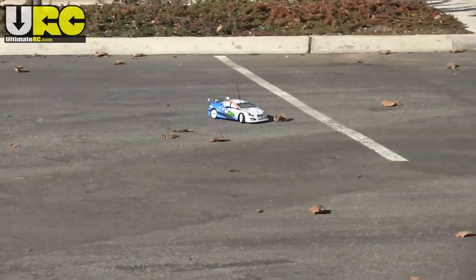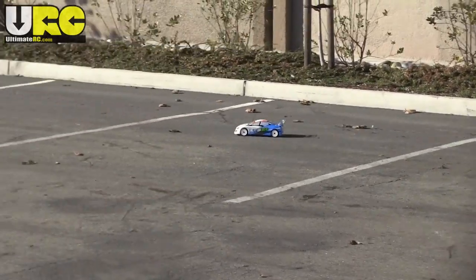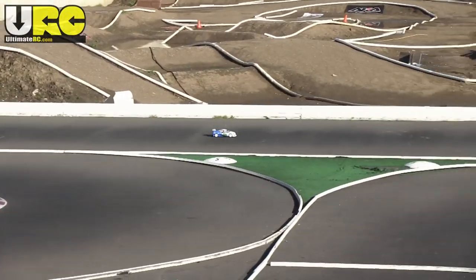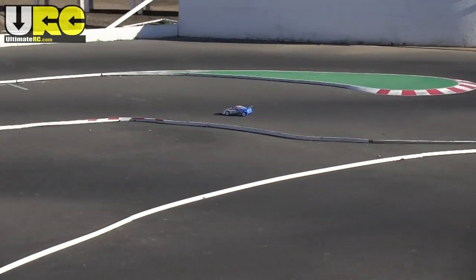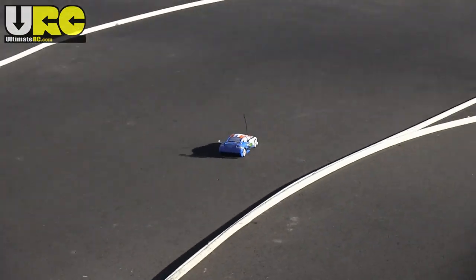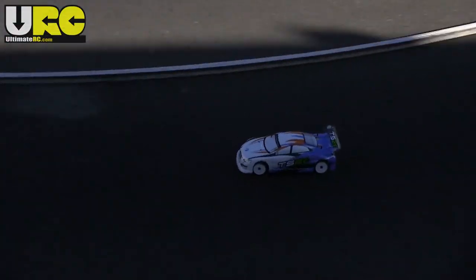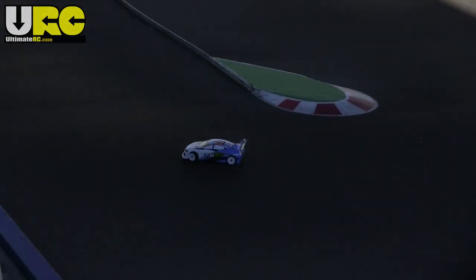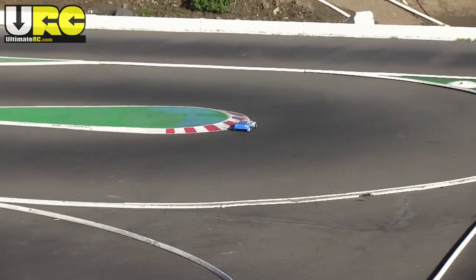Interestingly enough, even with its limited weight bias, the car still has a lot of front tire scrub and understeer at speed. On a track, the TS2e is very smooth and not very difficult to drive. It's just exceptionally slow. You do want to really plan your turns in advance and use the understeer front tire scrub to slow the car into turns. Two-wheel drive means two-wheel braking. If you use the brakes and you're not going in a perfectly straight line, the rear tires will almost always lock up and spin you out.